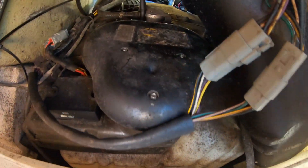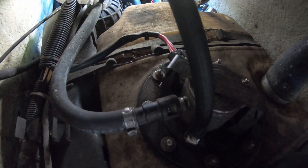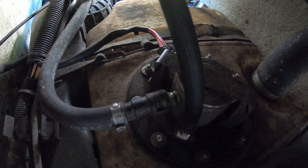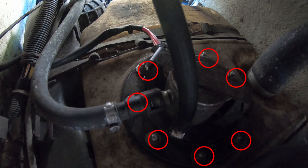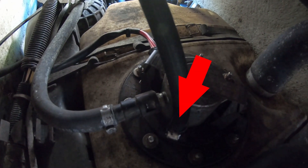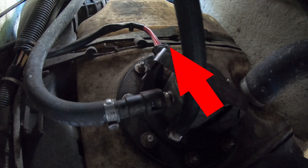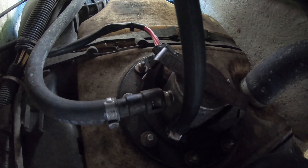Going inside the front of our Sea-Doo, sneak back in through here. This right here is the top of our fuel pump module. It's kind of difficult to see, kind of difficult to get a camera in there, but there are a whole mess of little eight millimeter nuts that hold the module to the tank, as well as the high pressure out, and the vent, and an electrical connector for the pump power, as well as the sending unit for the fuel gauge.